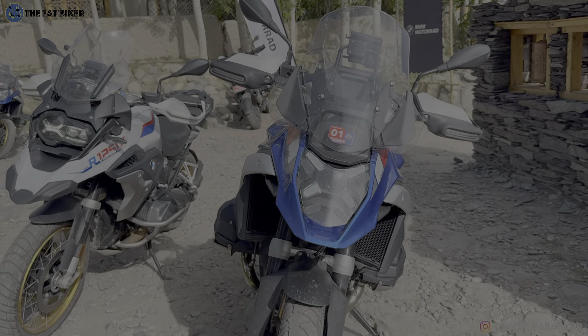The boot is going to be differently designed and bigger on the 1300. They've also managed to fit a longer swing arm on the 1300 compared to the 1250 - visually it actually feels like the 1250 has the longer one, but in reality it's the 1300. The swing arm is longer but the wheelbase remains identical to the R1250GS. The shaft inside is now stronger and it is recommended to replace it at 80,000 kilometers versus 60,000 kilometers on the R1250.